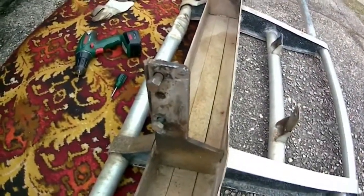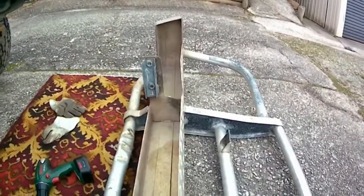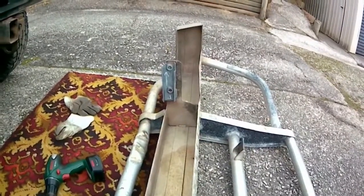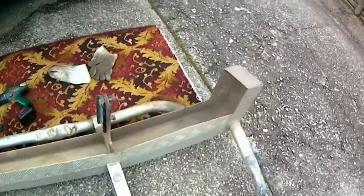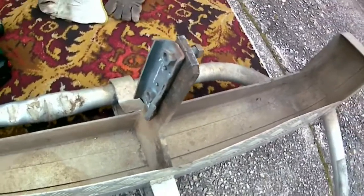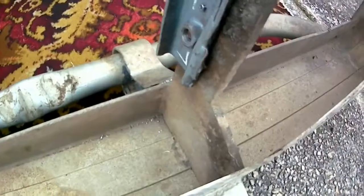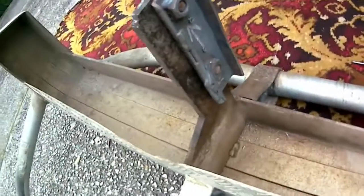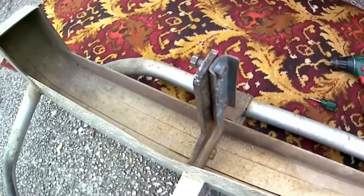What I decided to do was cut up the actual mounting brackets from the original bumper bar and line them up with this new bull bar. There are the bolts there, and I've got two small self-tappers — very small so they don't actually weaken the aluminium, because this is all an aluminium construction. I've done that on both sides, so there are a couple of little self-tappers there and they'll pretty much stay on.